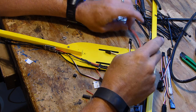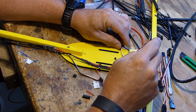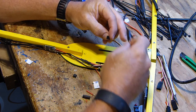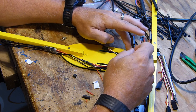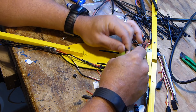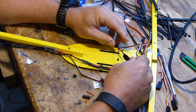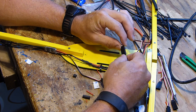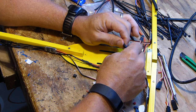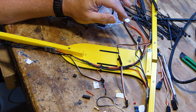We're back — we've got the negative side run. We're going to close this thing up and put the top plate on. We're done underneath with the wiring. The only thing left is putting on extensions onto the board. Since we didn't extend the speed controller wire inside like the old design, and since we put the ESC on the outside, we need to add extensions to reach the board. You want to make sure the extension connector doesn't pull back out — so either glue it, hot glue it, or use heat shrink big enough to bind the connection together.